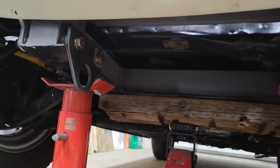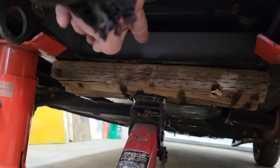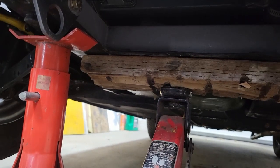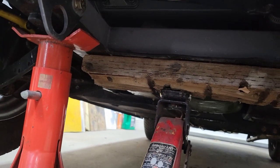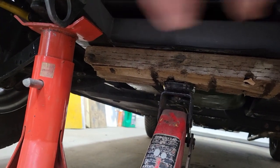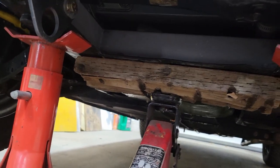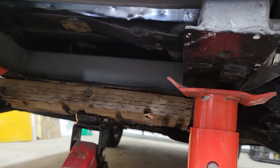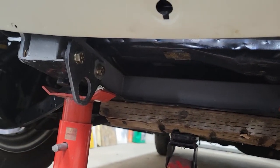Here's a bit of a tip for jacking up the front of your car or your bug eye. There's a box section that goes across between the frame rails, and the temptation is just to jack up in the middle of that — but that's not really recommended, otherwise you'll just dent the bottom of it and possibly put a hole in it. What's recommended is to use a piece of wood that goes from frame rail to frame rail and use that to jack the front of the car up. Then the jack stands go underneath where the sway bar would mount, so the car is really secure and not going to go anywhere.